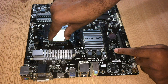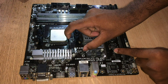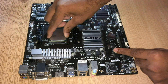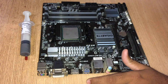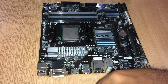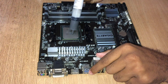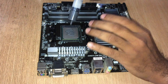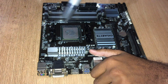Make sure it's nicely placed and lock it back. Make sure it doesn't come out easily. Before mounting the fan on the CPU, you must apply a layer of thermal grease. It's very important — it cools the processor and is used to thermally transfer heat while the processor is in use. Don't put too much because it heats up and spreads all over the processor.